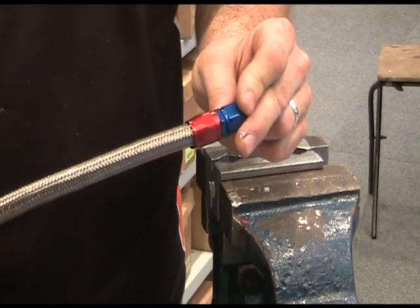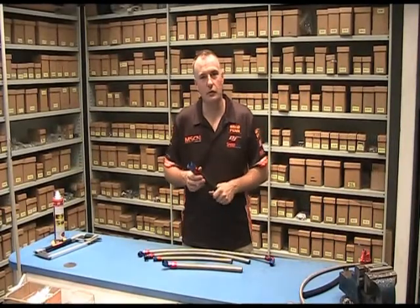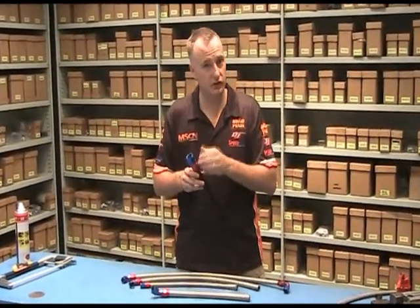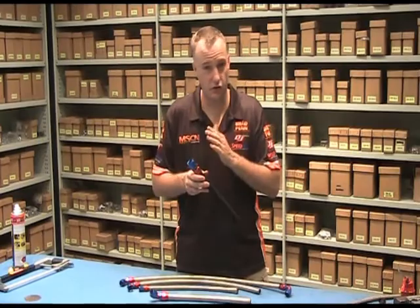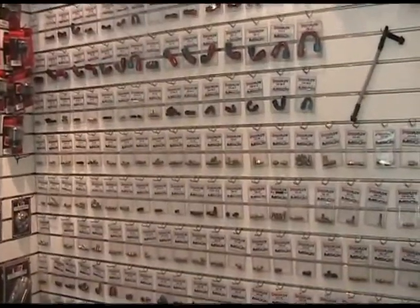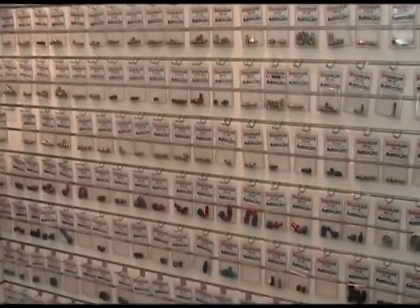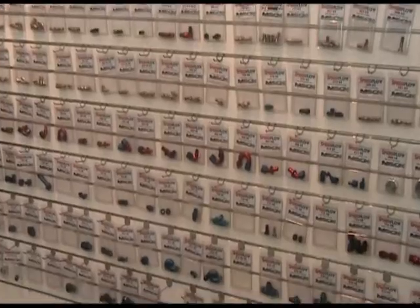You're then ready to put it on the car. A lot of people come to us every day of the week and they ask, why do you use Speedflow hose and fittings? The answer is simple. Unlike other brands, Speedflow uses 6000 and 7000 grade alloys. They also hard coat anodise all their products, which makes it suitable for methanol and salt water applications. A lot of other brands, to cut costs, do not do this. Their inventory range is massive and quite simply, they're the best.